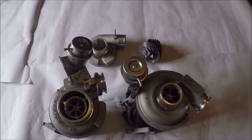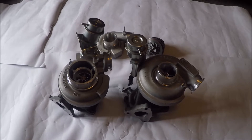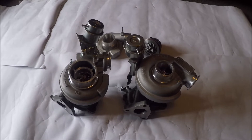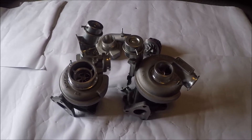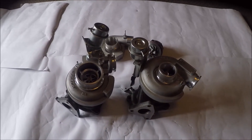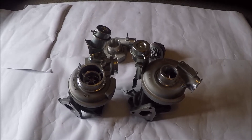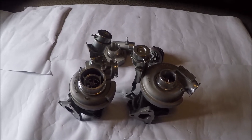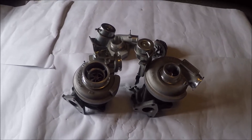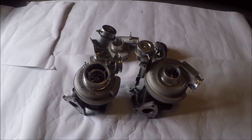All the small frame Holsets — these plus the original HX25 and HX27s — were built in conjunction with Mitsubishi, who make the famous TD04 and TD05 turbos. These are almost like the ultimate evolution version of a Mitsubishi TD04 turbo. They share some of the same parts and some things are interchangeable, but generally they're like an ultimate higher-flowing version with better compressor and turbine wheels that flow more and are more efficient.